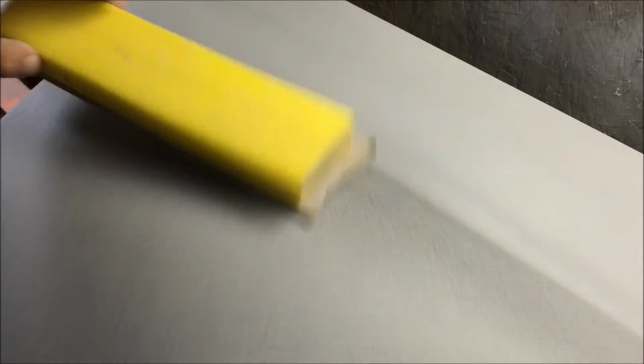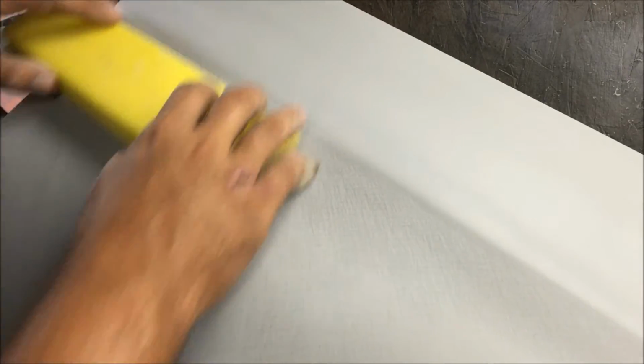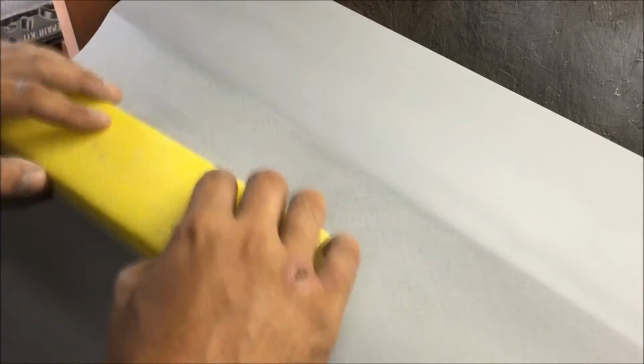Okay, so we've been blocking it with 180. You're trying to block those sand scratches out, low places out. That's why it's so hard to knock this out, because we're not just sanding in here, we're blocking it out as we go across the whole thing. See, we finally got everything where it's about to block out real nice. We don't have any low places indicated by that anywhere. We've polished this out completely with 180.